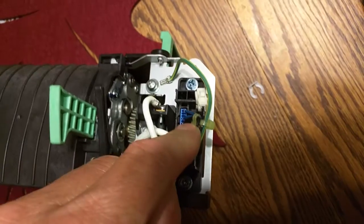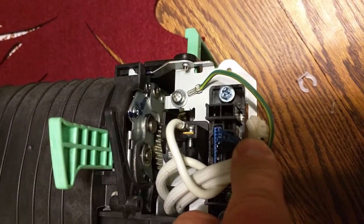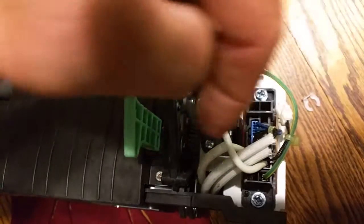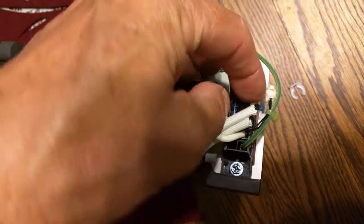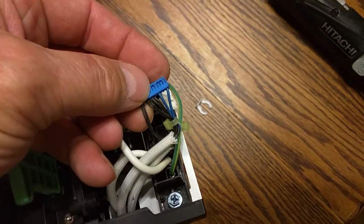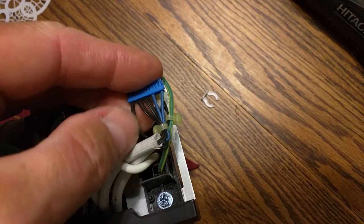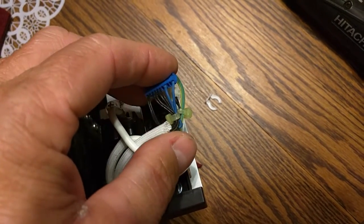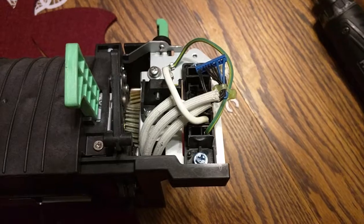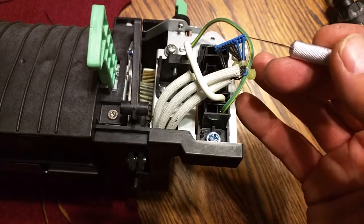On the other side, there are some little tabs that hold this thing in. It's going to be hard to get really focused in on it, but on this left side right here, you'll just press on some tabs and then this connector will pull right out. I've already done that, so I'm just going to pull it straight out. When you look at this connector, it's got two blue wires on it. This is the printer version, and when I want to modify it to go into the copier, I will move this blue wire right here — this one that's on the very first pin — and move it to the second pin.